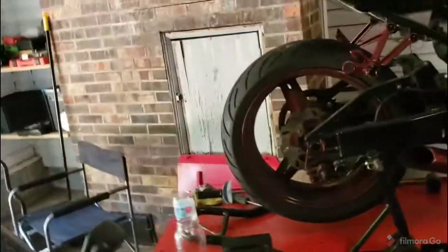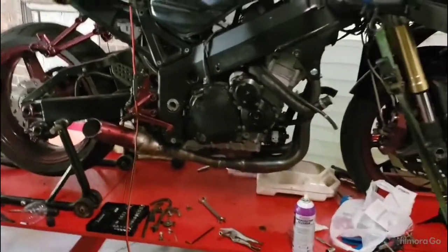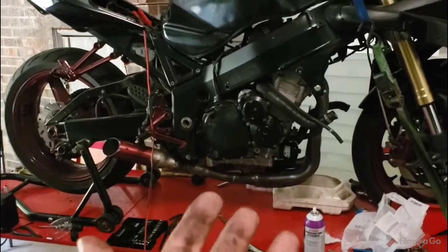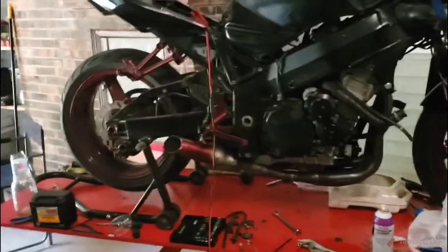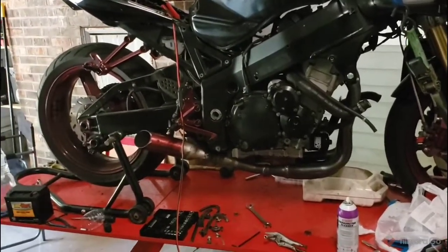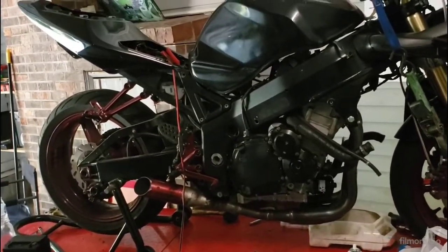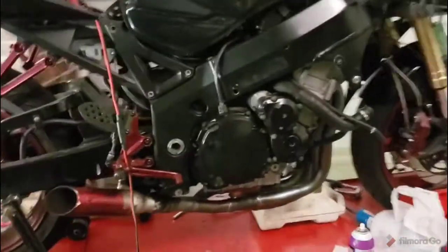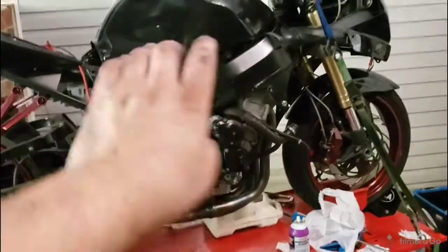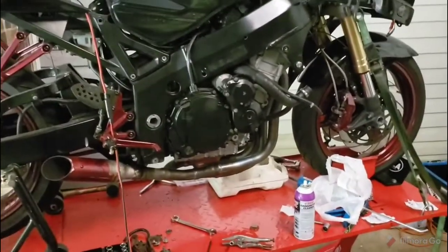What we've got is a transmission that is attempting to go into gear. The best bet normally for a GSXR is going to be a bent shift fork, so we're going to chase that. The engine will be coming back out. Hopefully we don't find the alternative, which would be either a bearing that rattles when it's not loaded, or a worn first or second gear face plate — the dogs. So worst case we've got to replace a gear and probably the correlated shift fork, because it's likely bent by then.